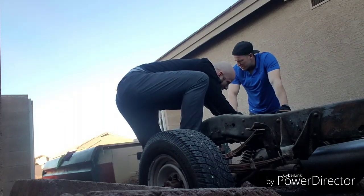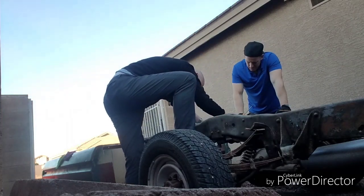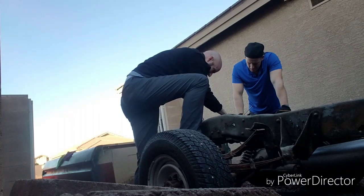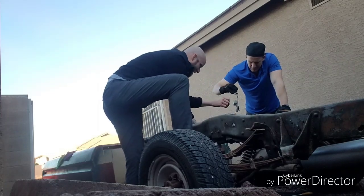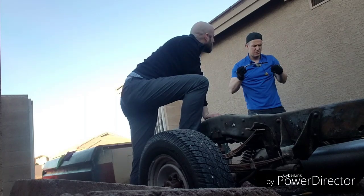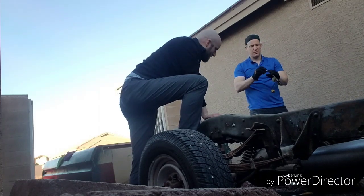Did you drop the tank though? No. Well, yes, but I didn't look through the top, which I regret. Just cut this off? Yeah. Does that still look okay? What is this? Is that rotted? This is probably like the preliminary filter. Oh, okay. But that could have broken loose and clogged somewhere up in the line. So I bet you that's why.